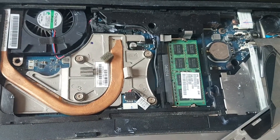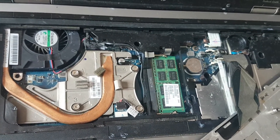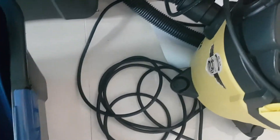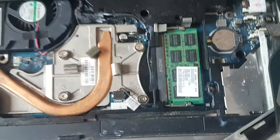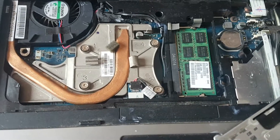I found a lot of machines in Thailand have failed because people just don't seem to understand the need to clean out the fan. I use quite a powerful vacuum cleaner — I'll show you, it's kind of over here. Sorry about the mess, it's my room. I got this baby, and why I like this thing is because it's got a sucking port and a blowing port. The lid's on the wrong way around so you get a face full of air coming out. But this blowing port you can use to basically blow stuff out in one direction. Don't blow it into the machine, of course. So use a high quality small vacuum cleaner and get the dust out.